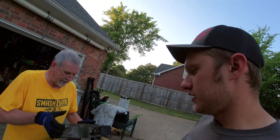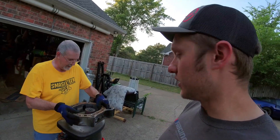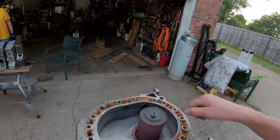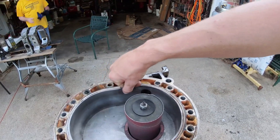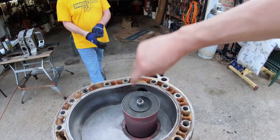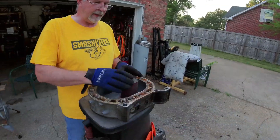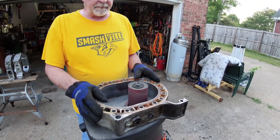It may not be usable in an engine that's going to be an OEM rebuild. But this housing is not damaged in the compression zone of the engine, so it would still start and run fine. You're just worried about catching an apex seal or something on this side where the gouges are — that'd be the only issue, or it causing excessive wear. But see what resurfacing can do to this side. We're just going to do a small section.